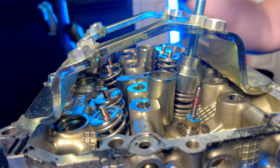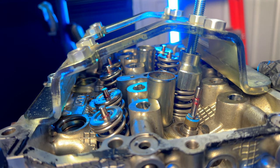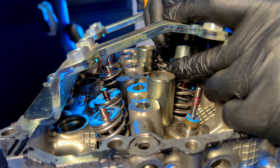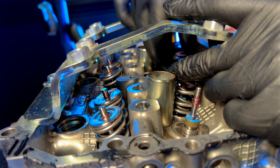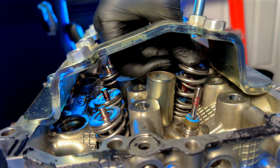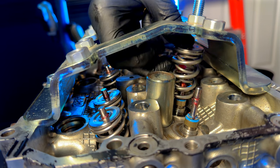I also want to advise you to take the valve stem seal off, as the friction from the valve stem turning in there and what we're fixing to do can burn off the valve stem seal. Fortunately, I'll be replacing them in this head — this is just for test fitting.